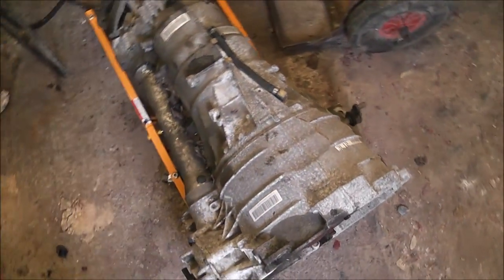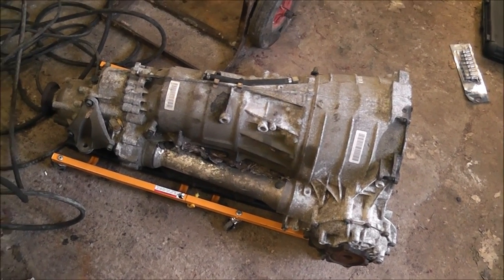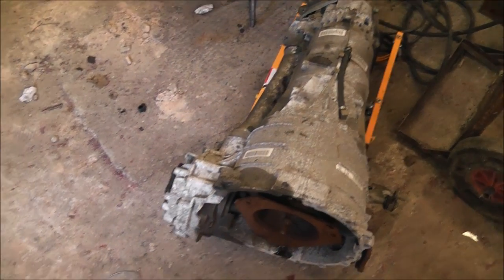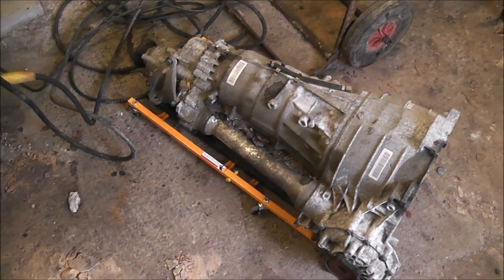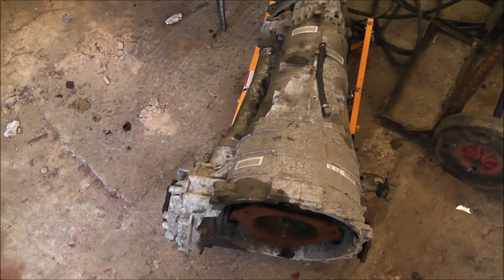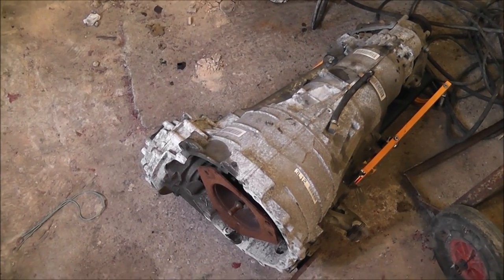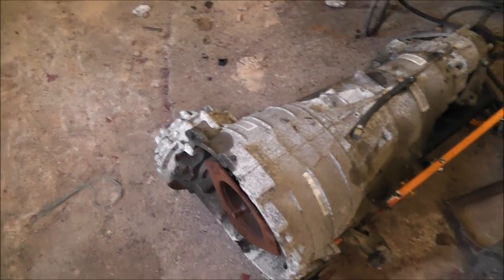I've taken this out of my car because I was having some problems with it. It wouldn't go into fourth, fifth or sixth, and usually that relates to a bush that has worn inside the gearbox. These are really really difficult to get out of the car. I had to strip off the whole front end — radiator, wheels, prop shafts, drive shafts — then drop the engine and gearbox together. I ended up buying a new gearbox and putting it all together. It was a real big job. It's 15 hour book time — a straight 15 hours non-stop working. It took me about two weeks to sort out because of uni and stuff.